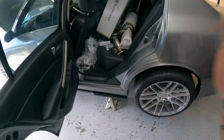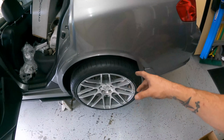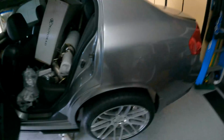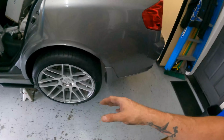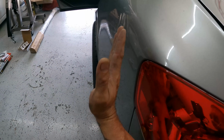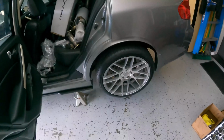So that way the drive shaft is done, the exhaust is done, and then we're gonna do the voodoo arms, really simple. Because Myke had the fenders rolled like this, it's gonna kind of change the camber or whatever. It's not changing it, but because it sticks out, we wanna be able to change it so it looks like it's tucked in the best that we can. Adjust the camber, and I think he just got camber arms. I'm gonna have to check and make sure. Sorry, he gets so much stuff sent to me that all I can do is kind of roll with it. So sometimes I forget everything that we have for all these builds. Either way, we're putting in voodoo arms for this, and we're gonna be able to adjust. I know the camber for sure, because you can see it's sticking out, and hopefully when it squats, the top end goes in a little bit, and if we can pull it in with the camber arm, hopefully manipulate and adjust how the wheels are sitting for the fitment. But yeah, that's what we're gonna do.